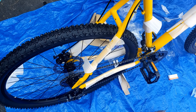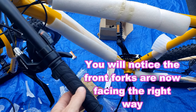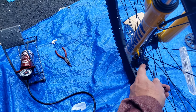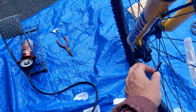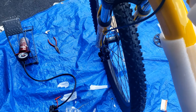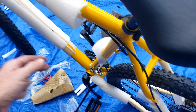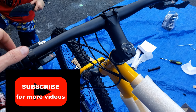The final two steps are to put on the reflectors on the front and back, and then pump up the tires and take it for a spin. Before you're done with everything, just make sure you check over every component. I noticed the thing that holds the brake in place at the front was loose — so it's important to check every component and make sure everything's solid before you take off. The back brake was already tight but the front one was not. Check all the cables, your brakes, your shifters, everything before you go, and make sure everything's working.